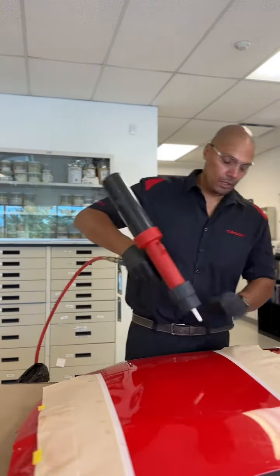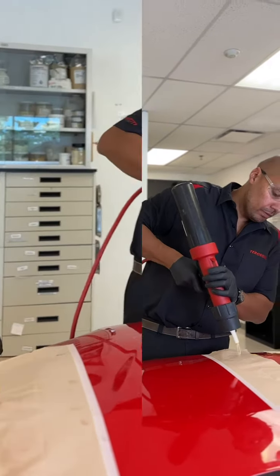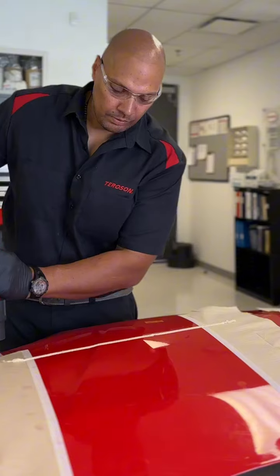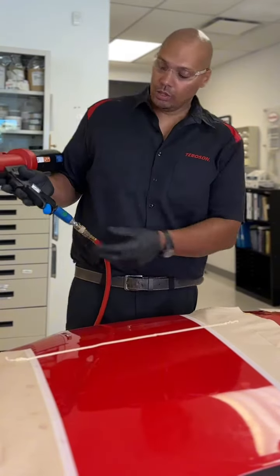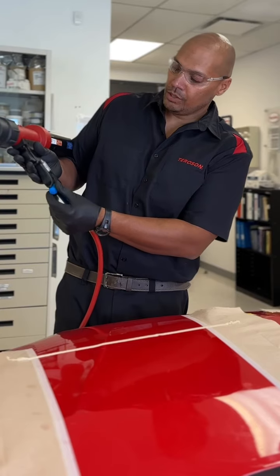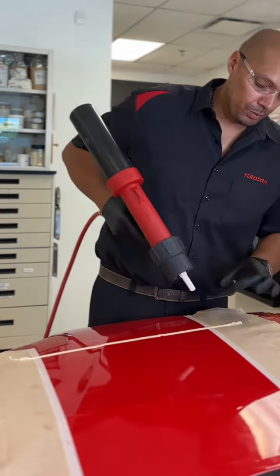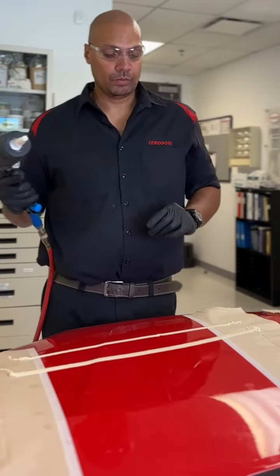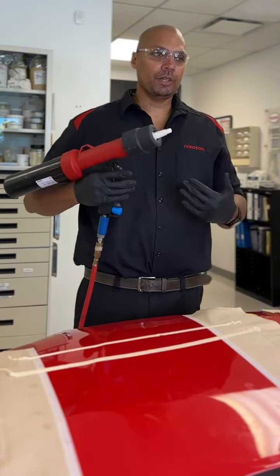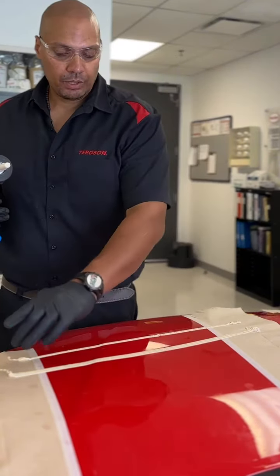Okay. So starting off the panel about 1 inch or 2, pull trigger down. Right. That's the size bead I get. So what I want to do now, too small, bump her up. So it's going up to, say we're at 12. You notice the actual bead's going to get wider. Right? So but those small increments, as you rise up in pressure, you start to notice the actual bead is going to increase the way you want.